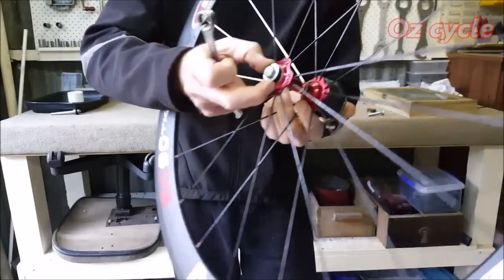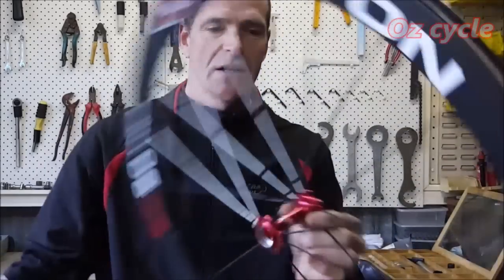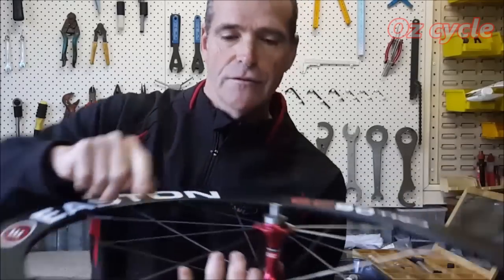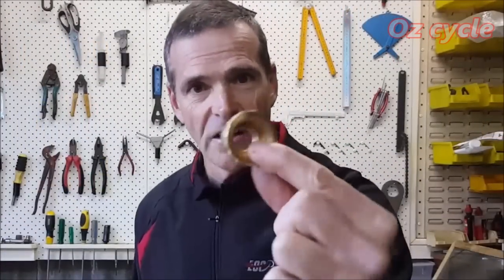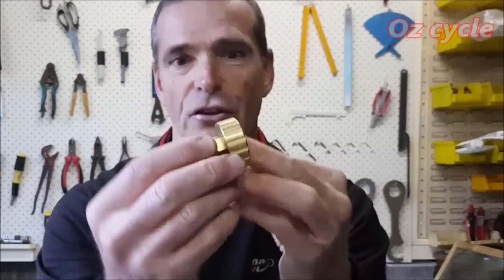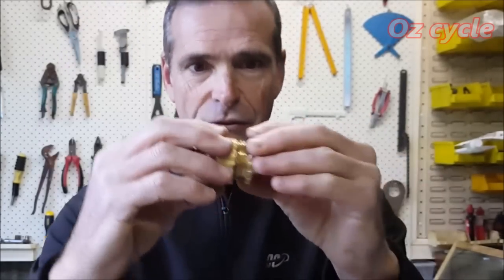The bearing's all the way in. Now to press in the other side. You have your bearing on your axle and that needs to go in the hub. Always put a bit of grease around the inside of the hub and on the outside of the bearing. Get your brass piece — this time you need to use the brass one, not the plastic one. These always come with a fitting that fits on your ordinary hose tap, so you need that piece as well.